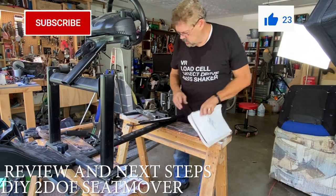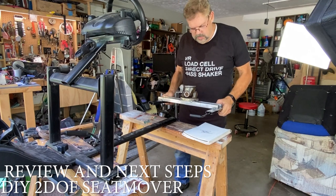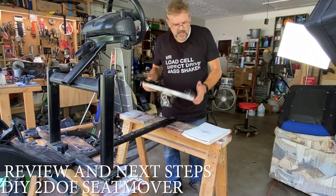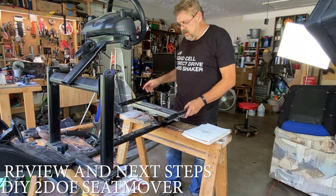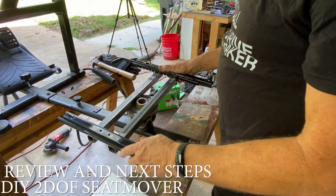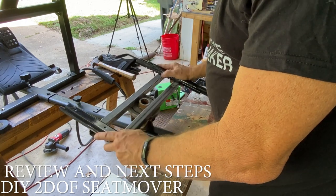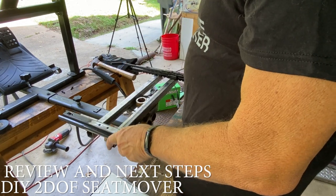We drew it up, we designed it, and here it is — a fully articulating seat frame. It might weigh 15 pounds, maybe 10 pounds. That's because of the U-joint, so you're not actually throwing all that weight around. We test-fitted it on the seat, which works. Since this is not gonna be my daily driver, I'm just gonna weld it on. There's actually more adjustability than I first thought — not only can I set the seat position, but I can also adjust it by moving this lever and sliding the seat back or forward if I need to.